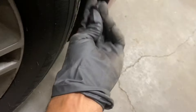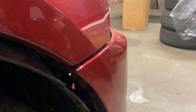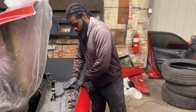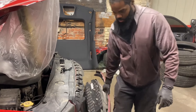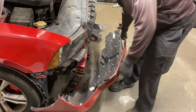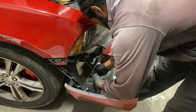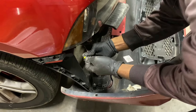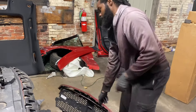Now on the side of the bumper — there are two clips holding in the fender liner and then a 10mm bolt right here. Zip that out and the bumper should come off. We literally just snatched the bumper off. Be careful because there are a lot of tabs on here — you don't want to break them. It just popped right out. The only thing holding it now is the fog light connector, so you lift up on the tab and pull out, and it comes free.